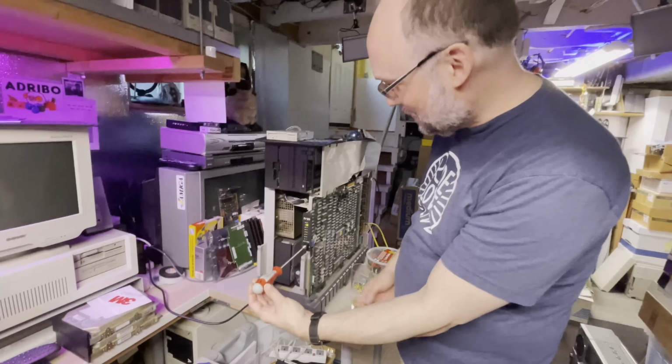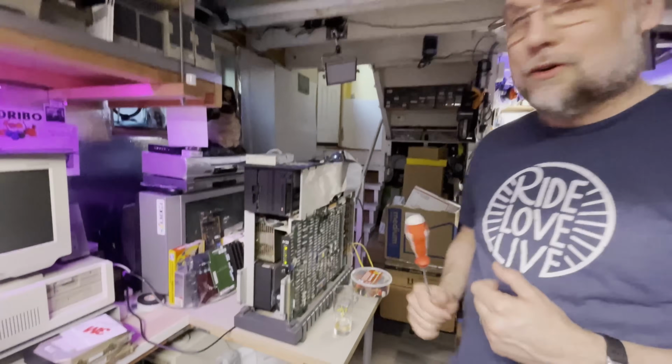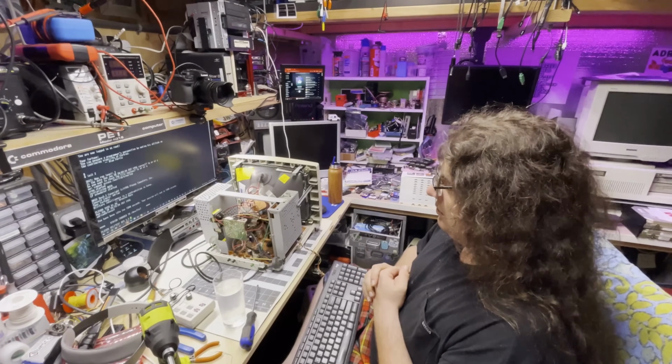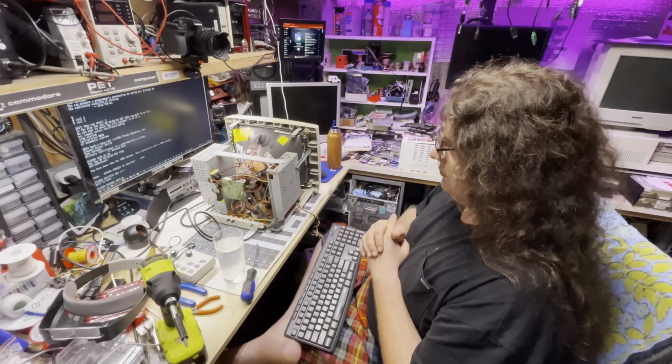Meanwhile, as a basic exercise to learn more about the system, I relinked the PLEXUS's kernel. Old versions of UNIX shipped its kernel binaries as a set of object files that could be modified to add or remove device drivers from the running system. It was for this process that I was able to change the boot version string as seen on the teaser clip I posted the other day.